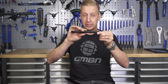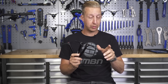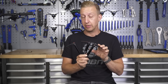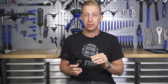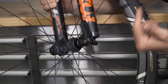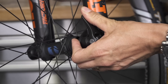The DT system simply screws into the frame or fork, and then you can adjust the position of the lever afterwards to orientate it in a suitable position. Whilst all these systems are fairly self-explanatory and easy to use, it's equally easy to not use them correctly. Common mistakes include over-tightening — using all your body weight on the lever — which can damage it. Under-tightening is also a problem: if they're not sufficiently tight, the axle could work loose and slide out, meaning you'd lose the wheel, which is very dangerous.